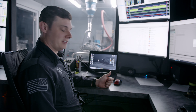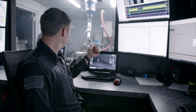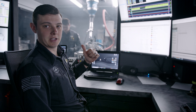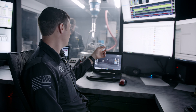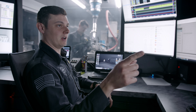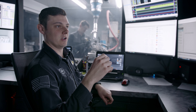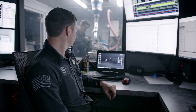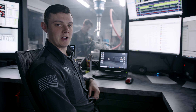We just finished compression with the analog gauge. Now he's going to do the same thing — screwing an adapter into the cylinder like before, but instead of hooking up to a gauge, he's going to hook it to our Pico scope on the other side of the wall. We'll record on this screen using the Pico scope to get more accurate compression, down to the tenth of a PSI. Once he's done setting it up, we'll start cranking.